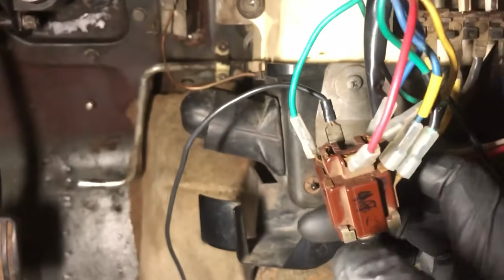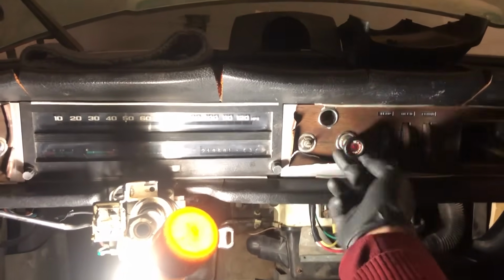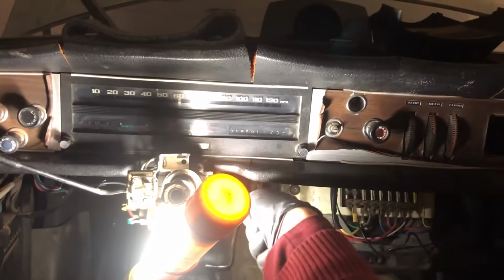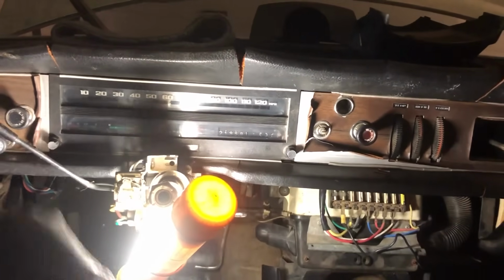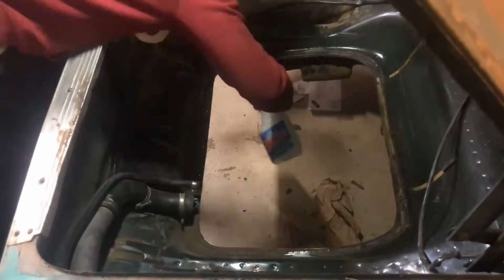But let's just take a note at the wires and the origin of them. And it does ground through the body of the switch. If you don't have a good ground in the dashboard, that connector there, that I, is actually what you would connect to ground. And so you got L and R, which is your left and right side respectively. This is becoming a long rant for a small task that was huge to me.